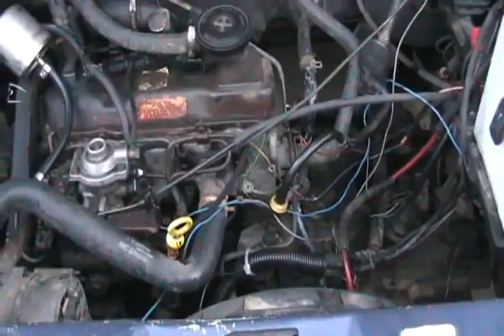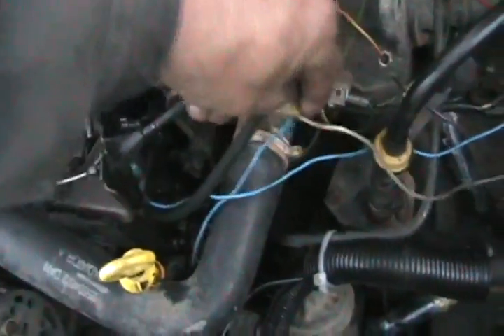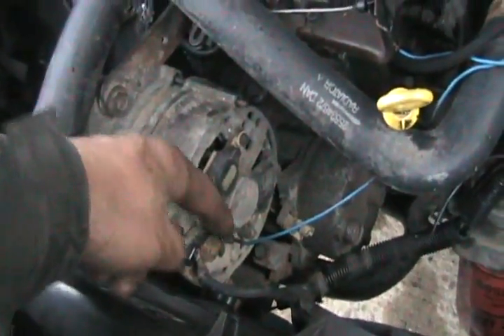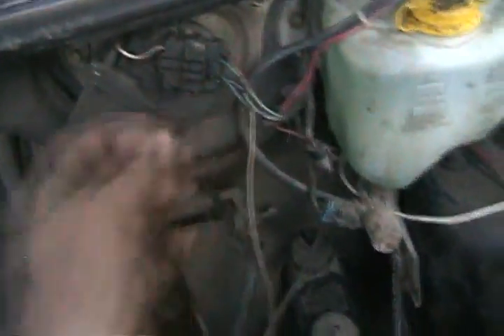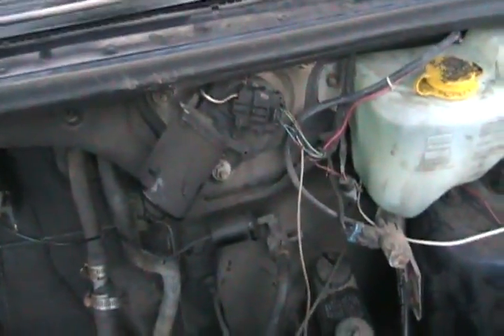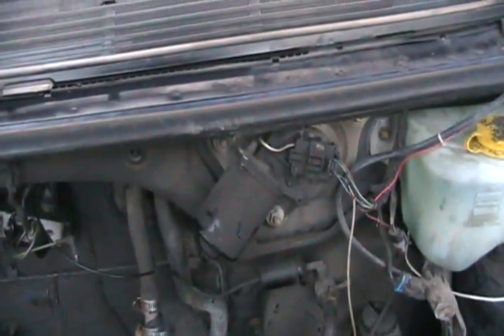I just thought of something. I remember I have these two wires — this gray one and this blue one. The blue one goes to the injector pump shutoff solenoid, and the gray one connects to that blue one. The other one just goes to the exciter circuit on the alternator. Well, I connected them both there, and that's the B-plus constant for the park circuit on the wiper motor.